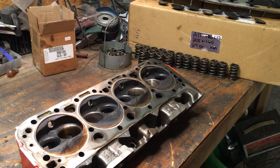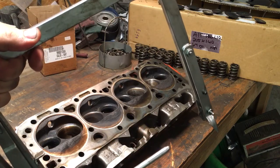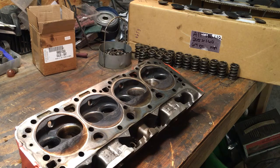I was having a heck of a time today using this big C-clamp spring compressor. It's a piece of junk — it's the kit you can rent from Advanced Auto Parts, but I borrowed this from a mechanic friend of mine. I am in the process of building my own big C-clamp version that uses an impact driver to compress springs on small block Chevy heads. I just haven't finalized my design yet, but as soon as I can get access to a welder I'll get that taken care of.